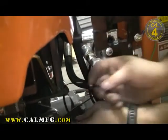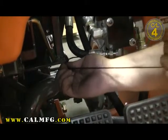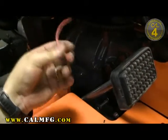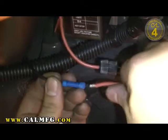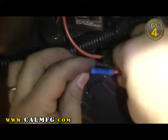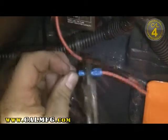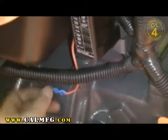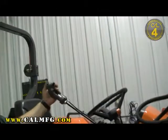I'm going to go ahead and secure my power wire over here. When we're finished, we'll go back and clip any of the ties that we put on. We'll leave ourselves enough slack that we can work on this connection and tuck it all back into that area when we're done. I'm going to go ahead and clip the black wire here, get those two ends exposed, and get both ends into our butt connector and then crimp it. If you have heat shrink, heat shrink works very well — it doesn't have to be done, but obviously the more watertight you can make the connection the better. Make sure that our wires are secure. We're going to go ahead and leave that connection as it is and try to put the excess under the console the best that we can. Turn our switch on now and you'll be able to hear the valves click, so we know that our valve is working properly.